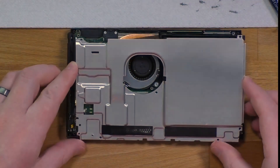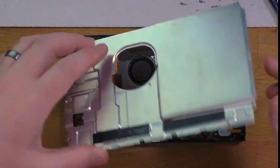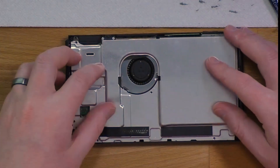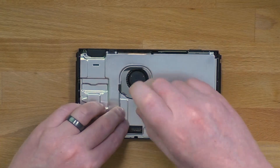After that's on, you can install the metal plate. I'll go ahead and take that off as well so you guys can see how that spreads out. Now put the seven screws back into the metal plate — there are six that go directly into the plate and then one that holds on the SD card slot.